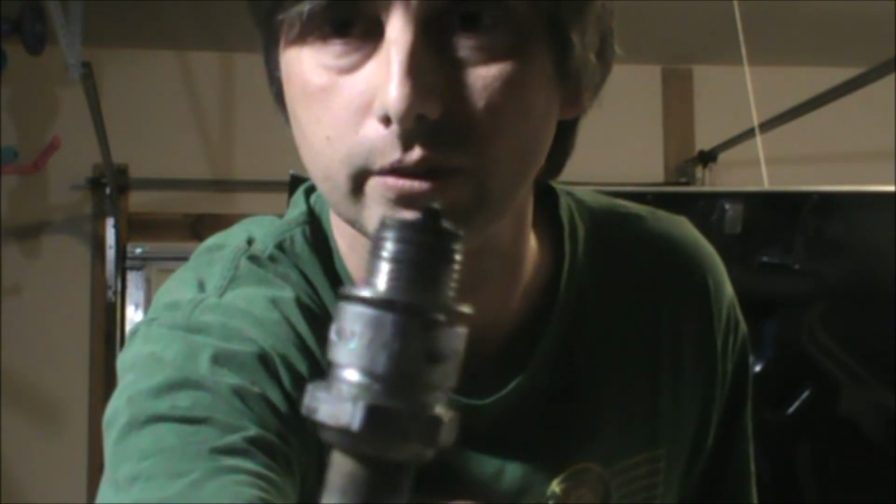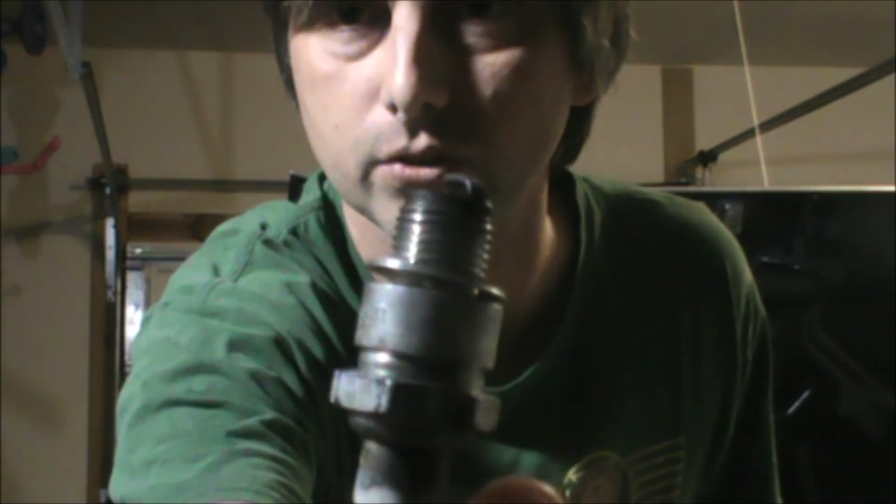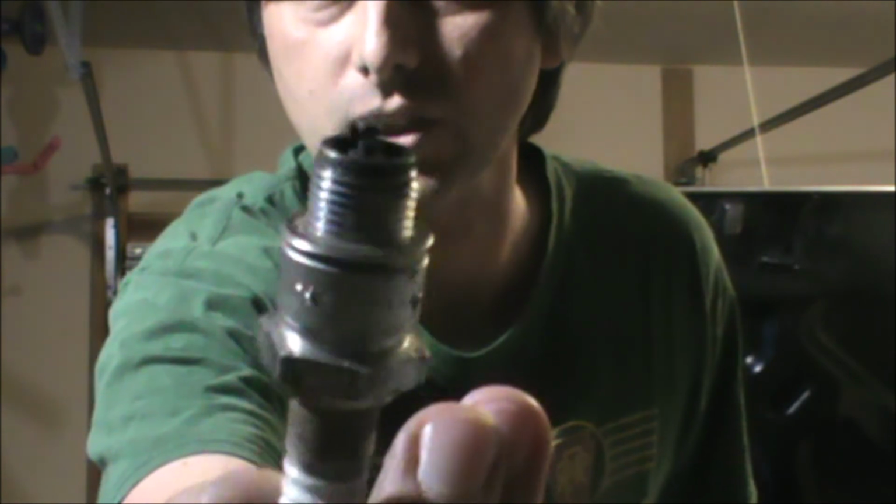So I've conducted the compression test on all 6 cylinders, and unfortunately, cylinder number 2 seems to have no compression. So this is something a bit more serious than just a lifter. Might be a dropped valve seat, so I'm going to have to take that cylinder head off, put the spare on, and hopefully that fixes it. You can see the spark plug for the number 2 cylinder, I can get that in focus for you, is actually quite fouled.